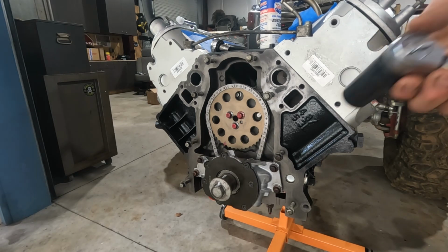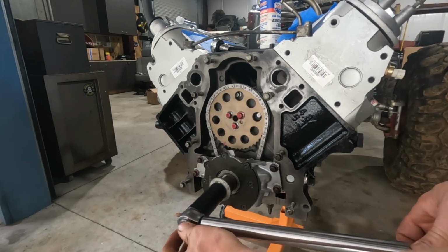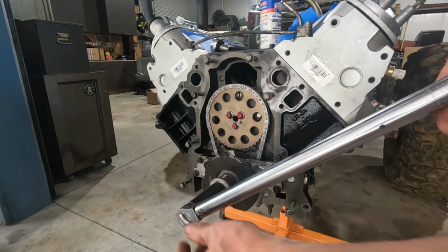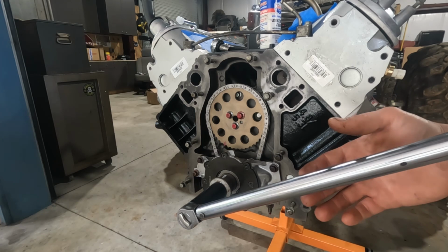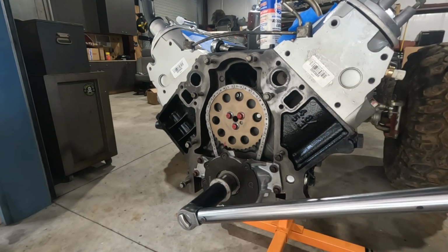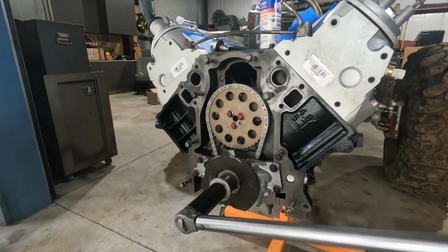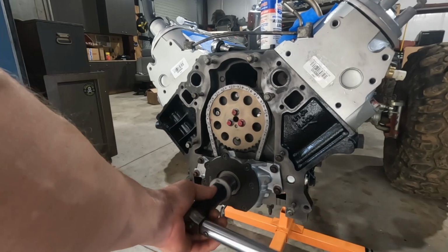This is straight off of Melling, the manufacturer of the pump. This is how they say to do it. There's lots of people that say shimming it, but the shimming it is more based on a high performance application. So somebody that's gonna be running this thing at wide open throttle and whatnot. So we don't need it for a standard daily driver, but for a daily, we can just do this method.